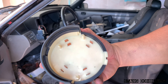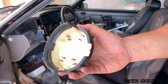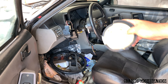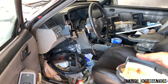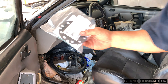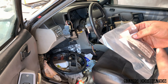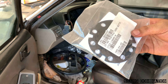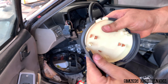I'm gonna start taking it apart to see if it's good or not — only way to find out is if you open it. Not too bad, not too hard. A lot of people out there — especially in San Diego — their 87-through-89 horn never works. Somebody either has it unplugged or the horn isn't actually there. A lot of people don't know about this: the horn pad goes right behind this rubber piece. You basically take it apart — it's pretty easy — and this is what causes your horn to stay on and have full contact. That's why a lot of people unplug them. This was about $11 when I bought it a few years ago.